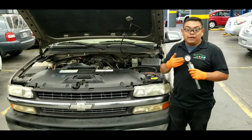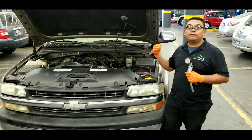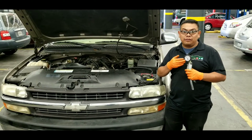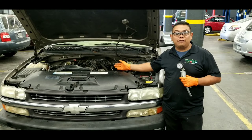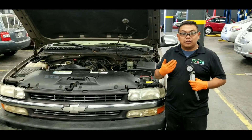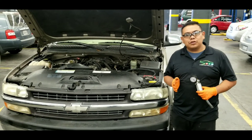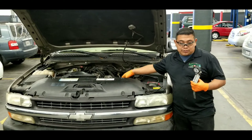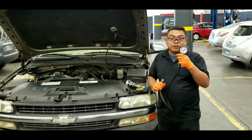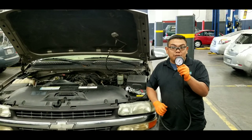You're also going to be able to use a vacuum pump to measure the vacuum the engine produces. This is a return-type system that has a fuel pressure regulator. The fuel pressure regulator works off manifold vacuum from the engine, so you want to measure the vacuum from the engine. The pressure on the engine will determine how much pressure you see on your gauge, because it has to respond to the driver's demand. When they accelerate, the throttle opens, air gets in, and you want pressure to build up. This regulator normally controls around 10 PSI, so your fuel pressure gauge should be able to determine that.